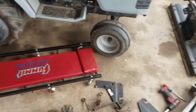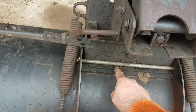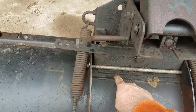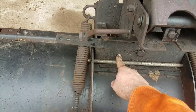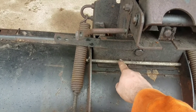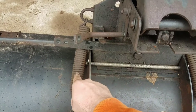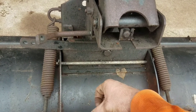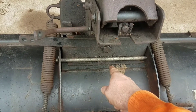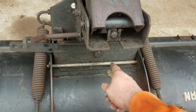We've had some rain this morning. One part that I don't have shown in the pile is this pin right here. This is a piece of flat stock that is bent at a 90 to the actual mount assembly, or frame assembly. With this pin in, this is a dozer blade. You pull this pin out and it will be a trip blade — a spring trip blade. Since I was using it just to move some rocks, I left the pin in. This pin is a little bit difficult to get in because the pivot points are a little bit worn on this, being that the plow is from 1986.